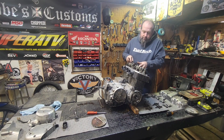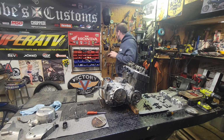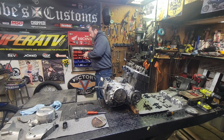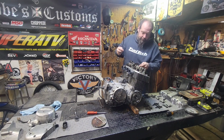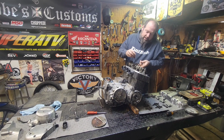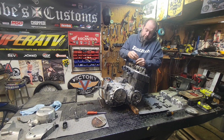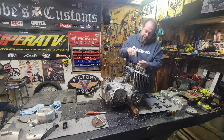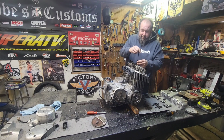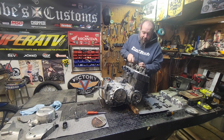And what I like to do, show you guys here, leave that in place for 1 second. You see everything's loose. Give me a nice zip tie here. And with the zip tie, I can zip tie it to the chain. And it's not if, it's when. When I drop that chain, I can pick it back up with the zip tie. It makes it super easy. Good old zip ties, can't beat them.